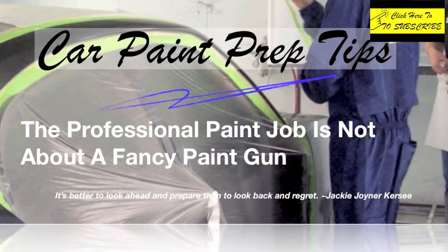I mean, there's going to be dirt in it where you didn't wash good. There's going to be fish eyes where all the silicone wasn't removed. Areas where it wasn't sanded good may have a paint adhesion failure where it starts peeling. Where you didn't mask good, you're going to see overspray. I mean, it's just going to look horrible. It would look like an amateur sprayed that car, even though it's someone with that much talent. So with that said, that puts it in a different perspective, to where the prepping has to be done right in order for the spraying to be right.